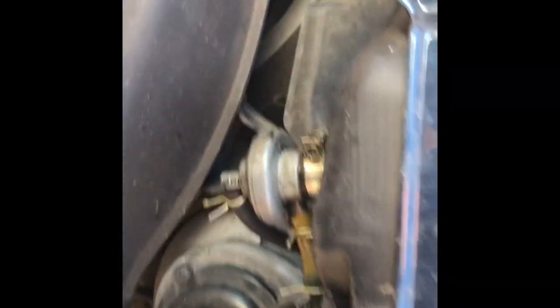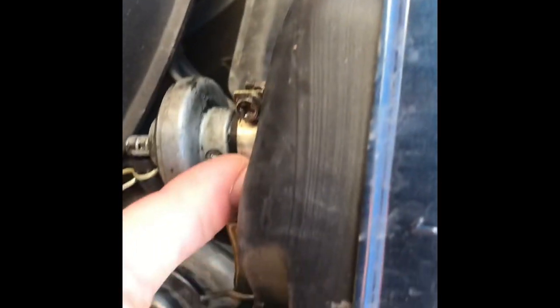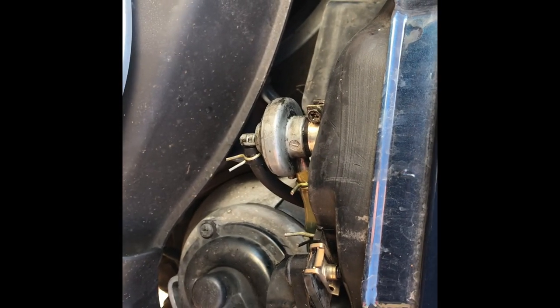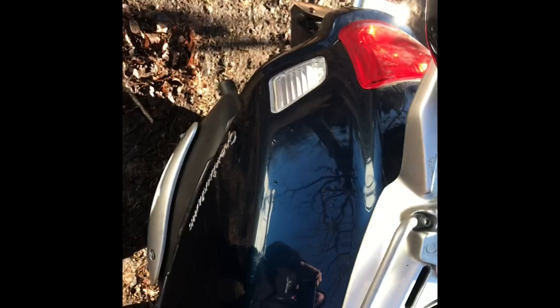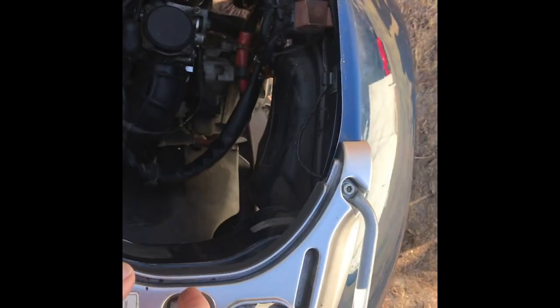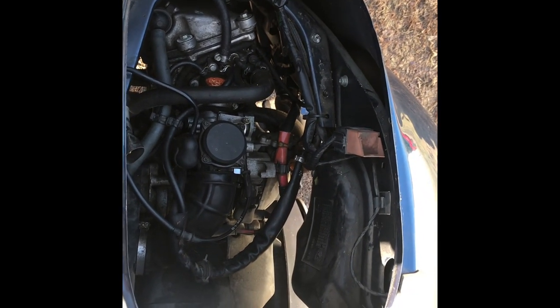That main jet was completely stopped up - that was the main reason why this bike wouldn't run. To drain the gas I put fresh gas in it - remind you this thing didn't run at all when it got here. I took this hose clamp loose right there and popped that drain and it just pours out pretty fast, so make sure you've got gloves on, safety glasses, step back a bit, and put a pan under it. Keeping the cap on slows it down - that was the easiest way to get the gas out of the tank.